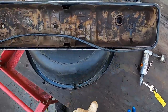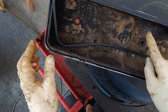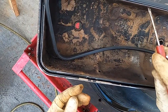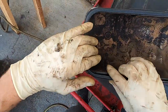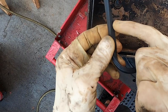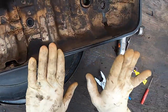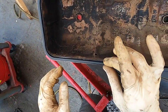And you kind of have to pinch it down in there. Speaking of pinching, I brought my pliers over because sometimes the gasket is not quite staying down in there. You can pinch the metal — this inside portion here. See how it's almost... This inside is a sleeve that runs inside the valve cover gasket. Yes, it's part of it, but it is slightly malleable. So stick your gasket in, and if these little bumps in the gasket — they're meant to hold the gasket in — if they're not doing their job very well, it's not quite holding in as nicely as what I'd like over here.